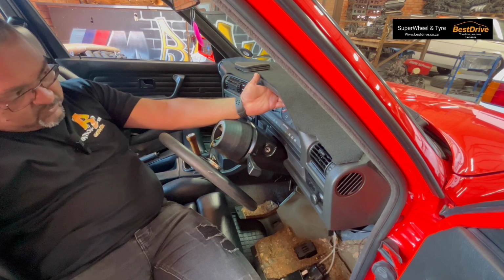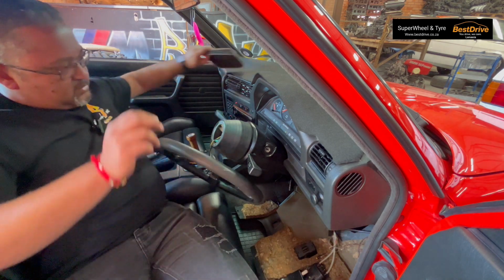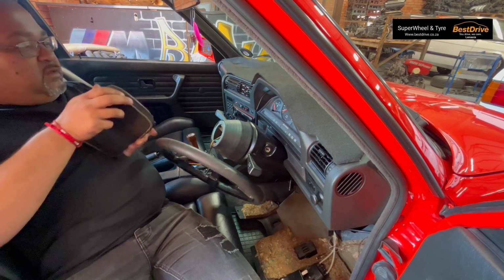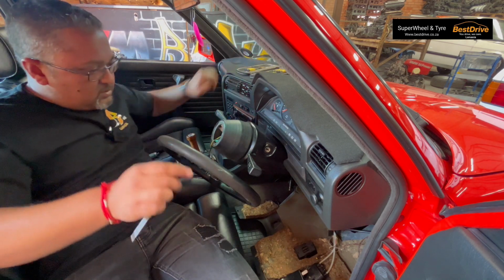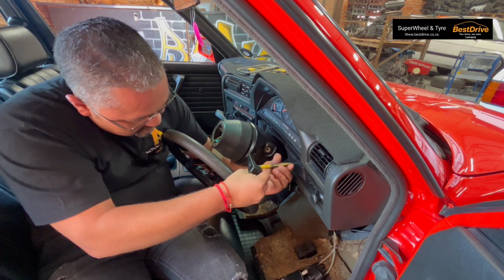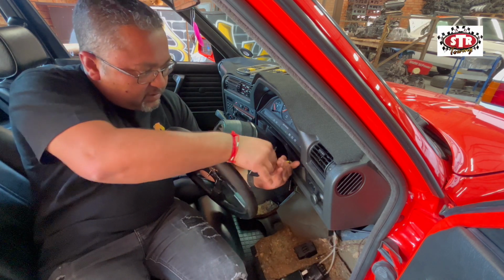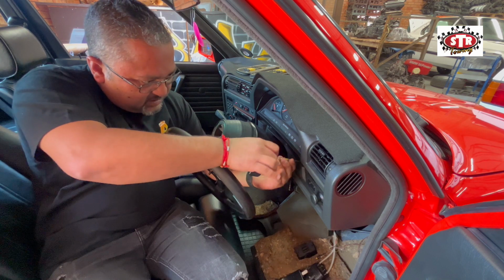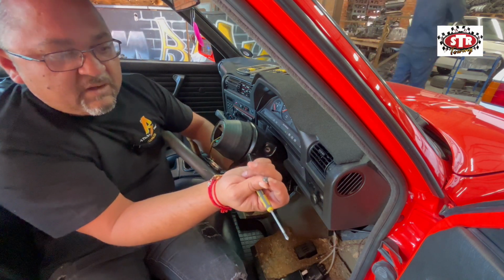So we've got two Phillips over here. We've got two Phillips over here, and you've got another two here. So guys, try not to move these Phillips, because the sizing is actually a very awkward size, right? So to get them back again is a little bit of an issue to find. You'll have to go strip second-hand cars, and even on the second-hand cars, because the clusters have been opened up again, you'll actually battle with them. You'll see it's a very funny sized Phillips head. It's actually a long flathead Phillips.